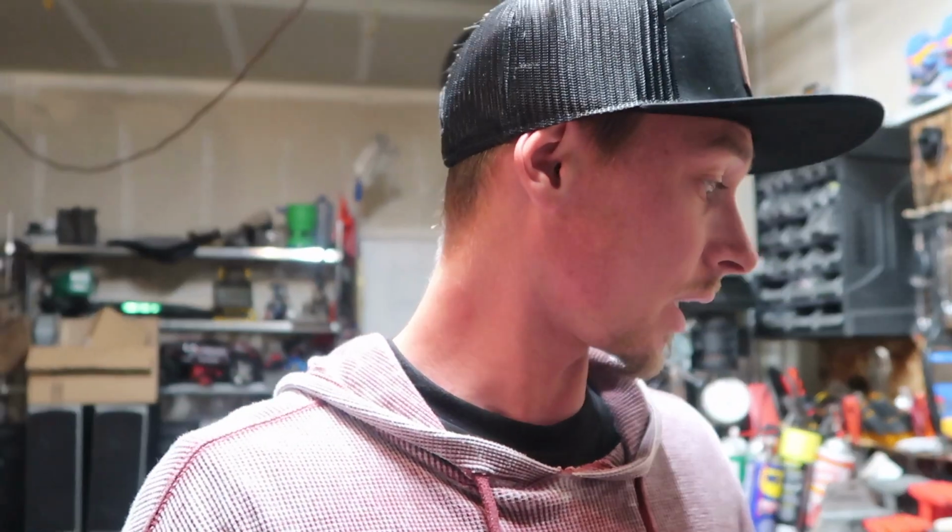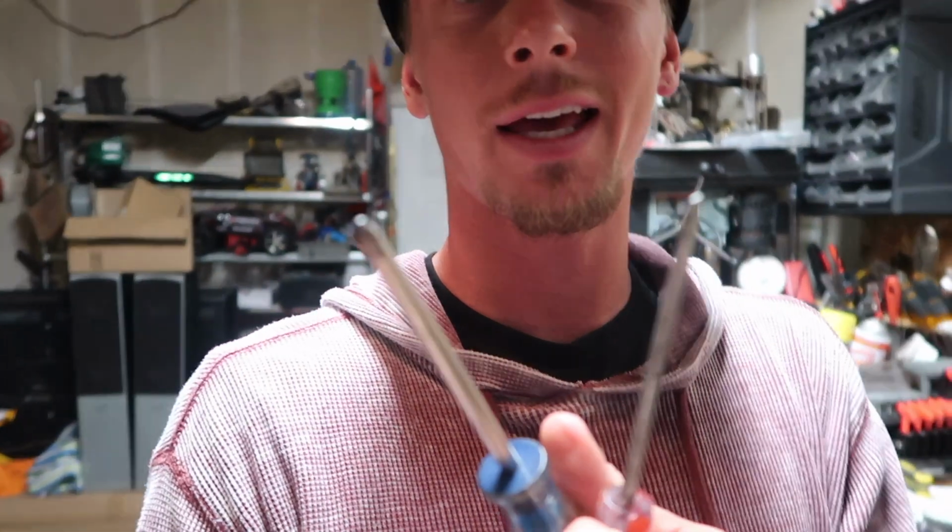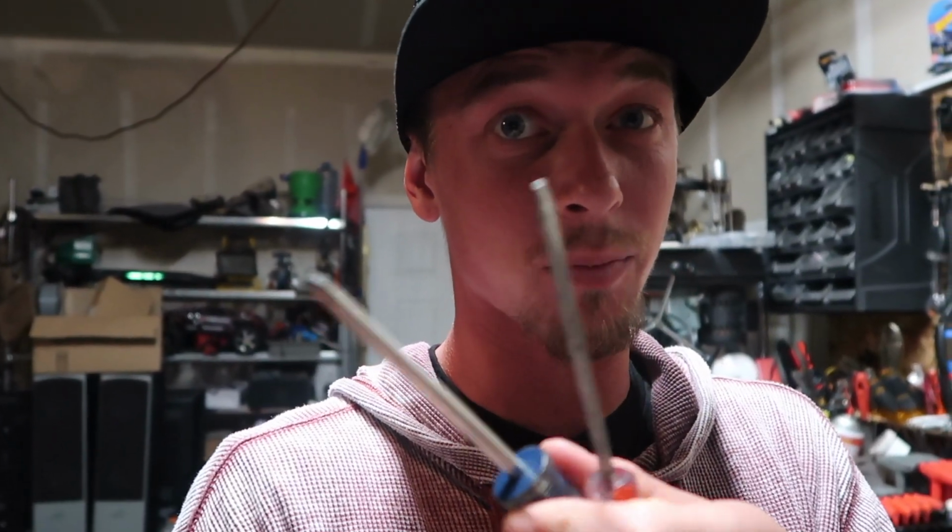I'll show you the easiest way I've found to take apart the dryer and get to the internals. It's real easy. All you're really gonna need is a flathead, maybe. The flathead's for prying, but you definitely need a number 2 Phillips. Number 2 Phillips is basically the only tool that you need. Up top there are 2 prongs that hold the front plate on that you might have to use a flathead. So you're down here, you're getting your tools, you might as well grab a flathead and a Phillips. So without further ado, let's go upstairs and check it out.